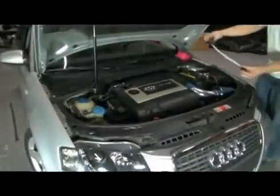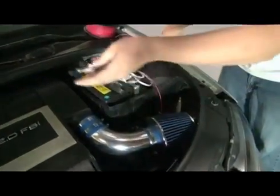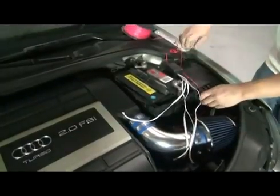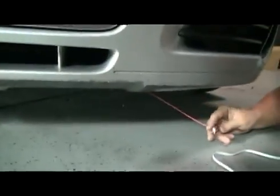Find a convenient spot under the hood to mount your control box, preferably close to where you can wire it for power. Once you've selected your spot, use a fish — like we've made here using wire and a washer — to feed the harness for the light bars down to the underbody so you can connect them. Feed the fish downwards. See it there coming through?